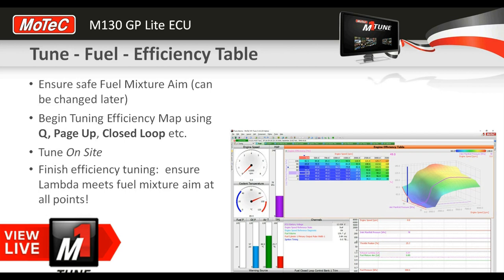a safe fuel mixture aim table. So this fuel mixture aim or lambda aim table that you're going to put in here, it doesn't necessarily have to be the end lambda that you're going to run, because you can easily change that later.